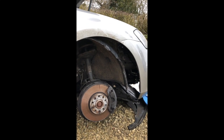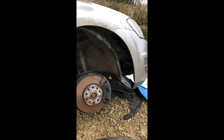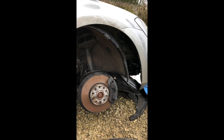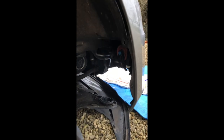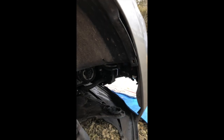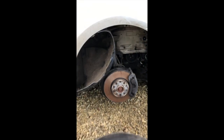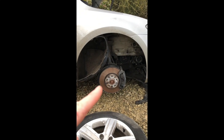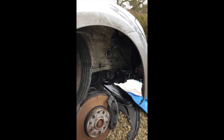The advice I was given was to go up through the wheel well, which is what's worked for me. Ignore the fact that there are lots of trim panels missing — I've had to do quite a bit of exploration to try and get this to work. Basically, remove your wheel: get the car jacked up, take your wheel off, and then remove the arch liner. I've just folded that piece of liner back on itself, out of the way rather than taking it off entirely, just to give me a good view and good access up in under the wheel arch.